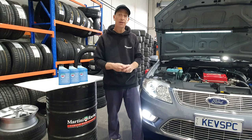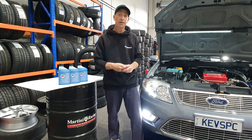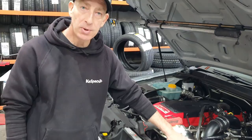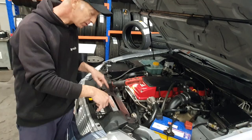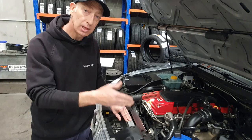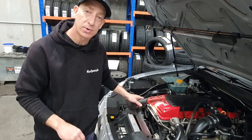I'll show you how to drain the radiator and flush this radiator flush out. All late model Falcons have a coolant drain on the radiator — there's a little tap down there. I've got the battery relocation, but for standard Falcons — 2003 upwards — you've got your air box and a little induction tube. There are two screws that screw it down. Just undo those two screws, remove your induction tube from the air box. It takes about two seconds. And down the bottom of the radiator on the passenger side, you'll see a little white tap. Undo that until the coolant starts spraying out.